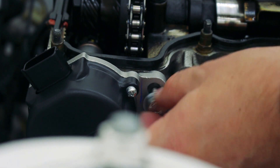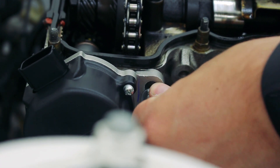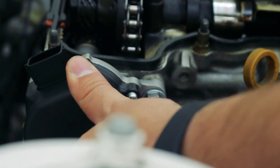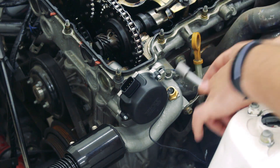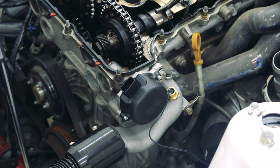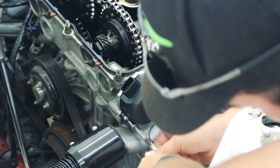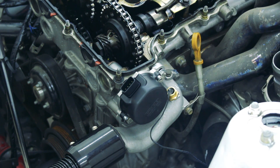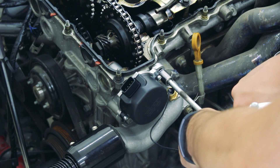This allows us to both advance and retard the timing once the CAS is in place. If the crank were out of orientation, there would be no way to get these bolts properly located while still maintaining the dots on the shaft. I have a perfect range of motion so I will be able to adjust the CAS as intended once it's finally installed. Now simply do the process in reverse, beginning with tightening the CAS bolts. Having them centered in the openings will put it in a factory position and will not mess with your timing. I cannot stress enough that it would be a really bad idea to strip the threads out of these sockets or to break the head off one of these bolts. Do not over-tighten with tools — these just need to be tight enough to keep the CAS from moving. Snug them down good and call it a day.